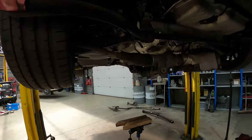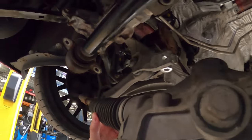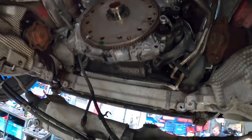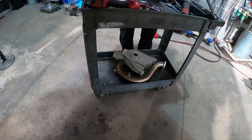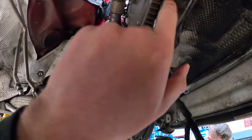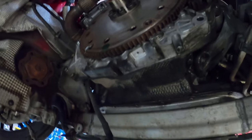So to get this out, we're going to take a lot of stuff off. Steering rack all drops down, universal joint pushed out away, transmission cooling lines, gear selector. Starter motor's just died in there - that's all slackened off. DPF pipe had to come out, which is a lot of work. And then the crank sensor itself had to come out as well, so I could fire the engine around to do the six bolts.